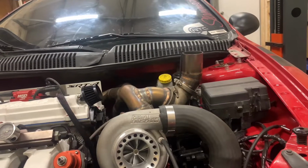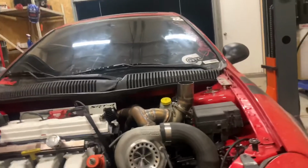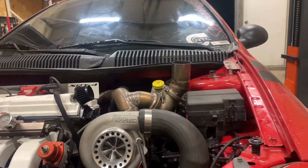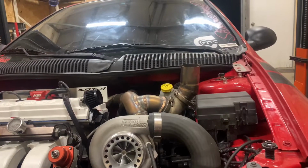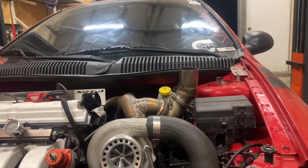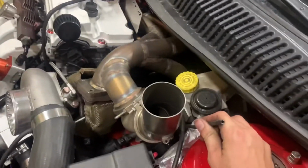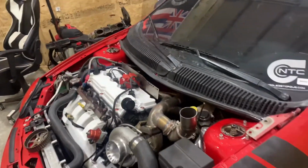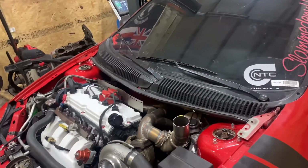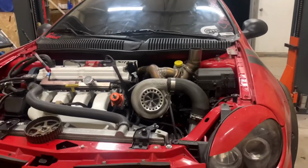So we went completely on wastegate pressure. It was stuck on 28 all the way through. And so we were about to put another spring in it and just make it manually 35 to 38 pounds at the end of the tune. And one of the guys next door was coming over from the exhaust side of the shop and offered to just use CO2 to the top of the gate, pressurize it as much as I wanted so we could get our tune done. He brought his tank over, we ran a line real quick. It took 2 minutes, and tune wise, we got to hold about 35 pounds for one good pull.